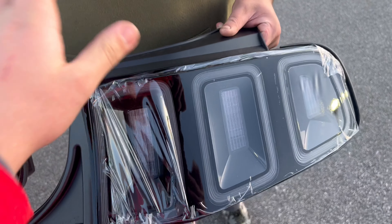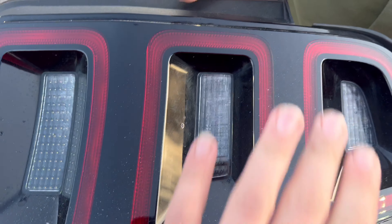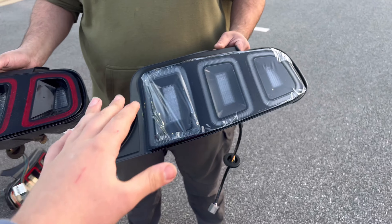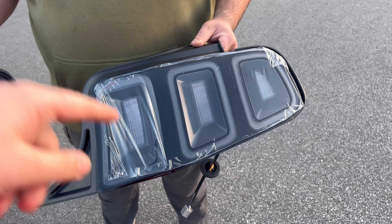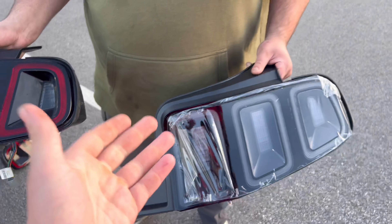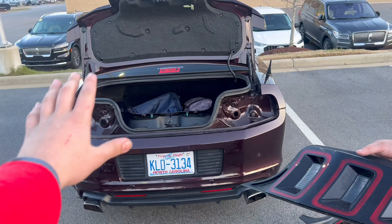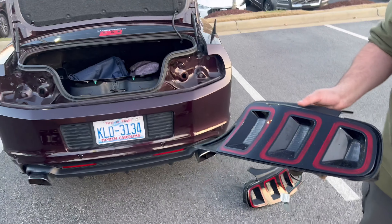So now let's get to the Euros in the box. These are the new Euro style — you can see it's just the white light, no red around it like the OEM ones are. Still LED in the middle here, plug-and-play harness. If you see here, the harness on these versus the OEM harness is the exact same. I'll leave a link in the description of what these are — I did buy them on Facebook Marketplace for cheaper, but I will leave where these came from in the description. The fitment on them looks like it's going to be good, so let's go ahead and slap them in the car — just reverse order, nuts on, connect the connectors, and put the trim piece in.